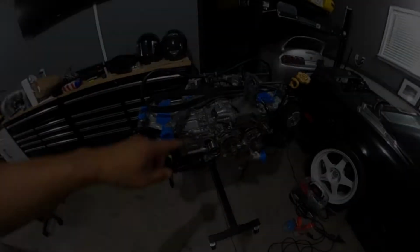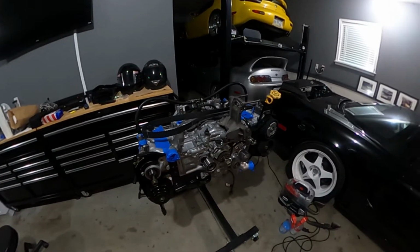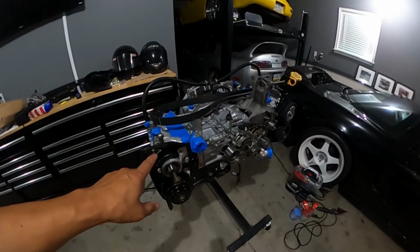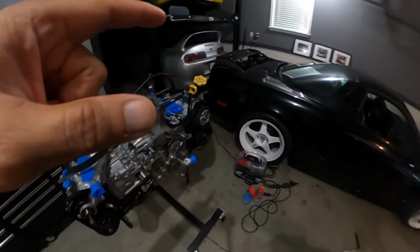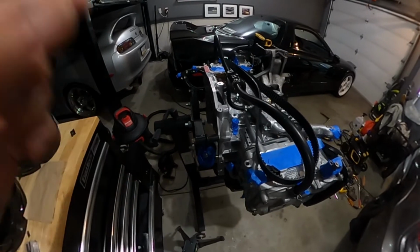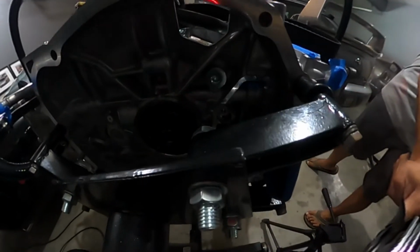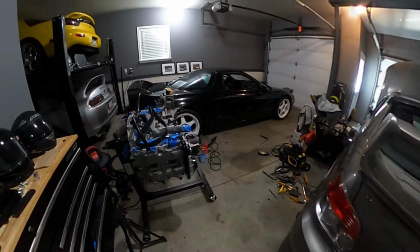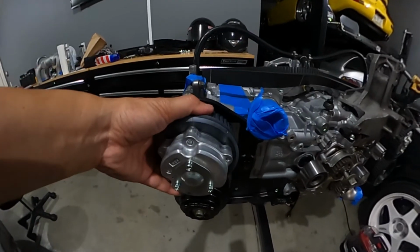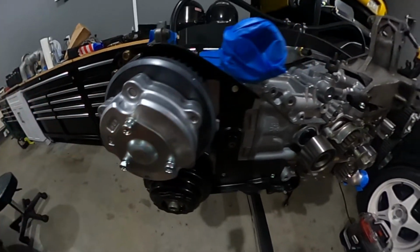intake cam gear back. This is the oil pressure switch that I was referring to that I am going to remove. I need to pick up still several things, but once I get this thing done, the timing and torque this properly, I am going to take this off and put it on the cherry picker, on the engine hoist, and start with the back end of it and put the flywheel, the clutch, you know, of course the oil cover that still needs to be placed on there. And then once I get that done, I am going to drop the motor in the engine bay.